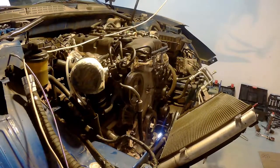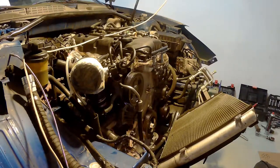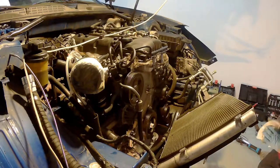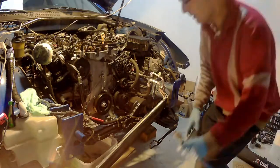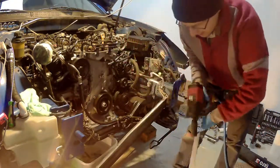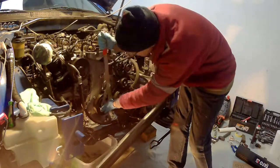Okay, so next is the oil pan and basically the crankshaft pulley. You can do it in any order, but it really helps to have a pneumatic gun that helps you with getting out the bolt, because it's gonna be in there tight. You can bet on that. You also need something to lock the crankshaft pulley from turning when you remove the screw. I used a special tool that I bought specifically for this occasion. You may have something else, but you need to block it. Otherwise, you won't be able to get the screw out of there.